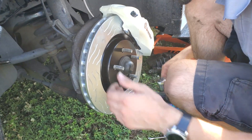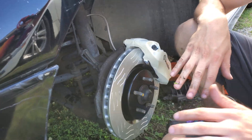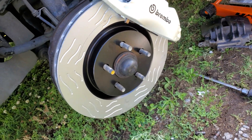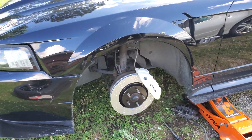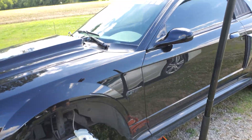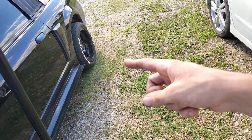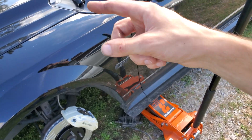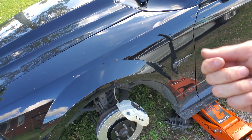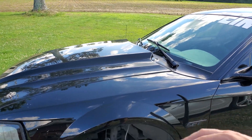And yeah, that's it. Now we just put the wheel on and then we're gonna have to bleed the brakes. There are different ways to bleed the brakes — I'm gonna do it with my sister. She's gonna push the brakes while I open the nozzles. Always start on the right rear, the furthest away from the master cylinder, then left rear, right front, left front. The master cylinder also has two bleeding nozzles — make sure you bleed that one too because it's important, otherwise your brakes won't work.